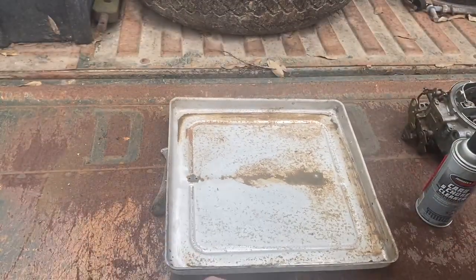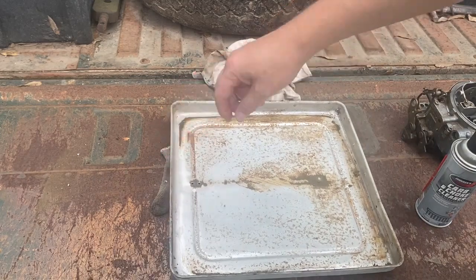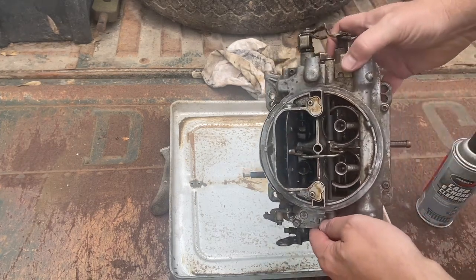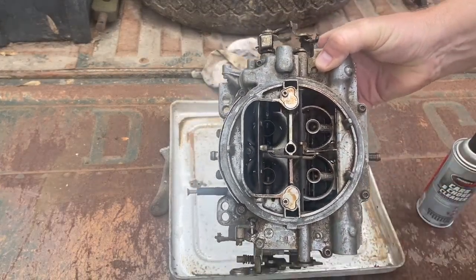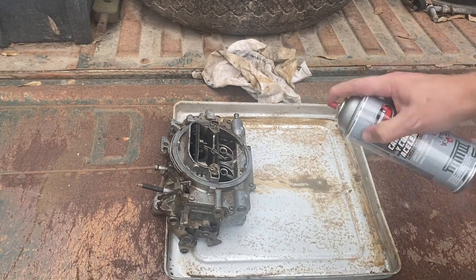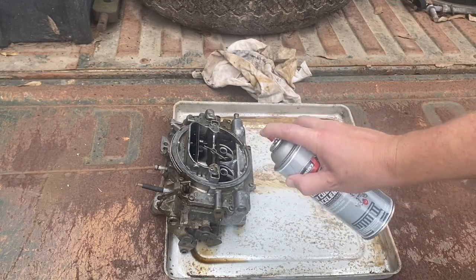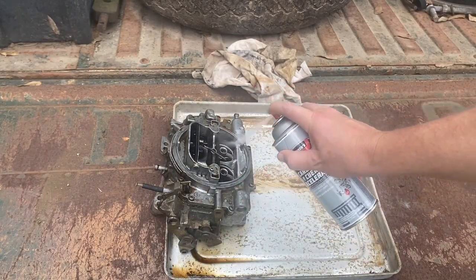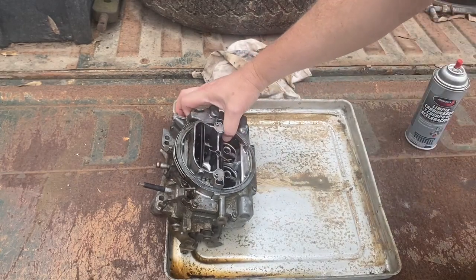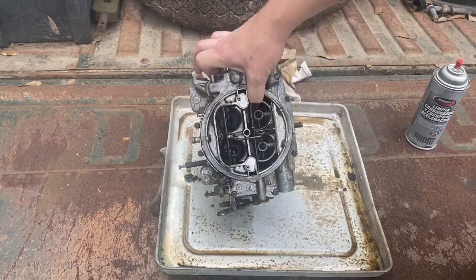Since we're not opening it up, I'm not worried about it being super clean, but I do want to see what's coming out of the carb and what's not. I've got an old nasty oil-soap glove underneath to catch drips so it doesn't go all over the tailgate. It's real gunky with a lot of residue in there, so externally we'll just spray it and knock some of that junk out. I hate the way this stuff smells, but you cannot argue with how good it works. Y'all might be able to see — let me let it go this way — yeah, that stuff's pretty gross. Flip it over.